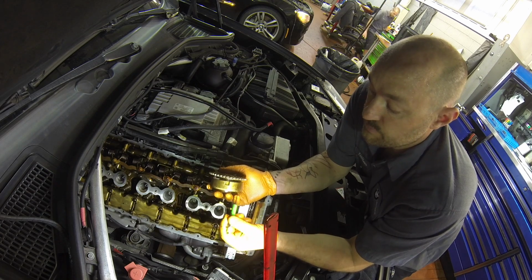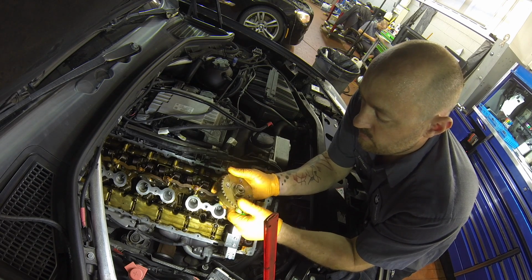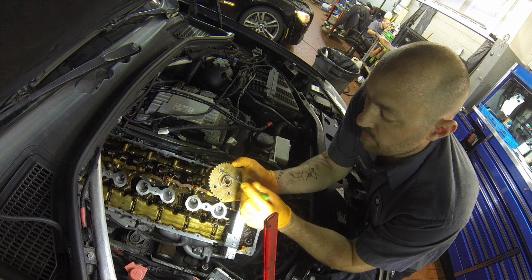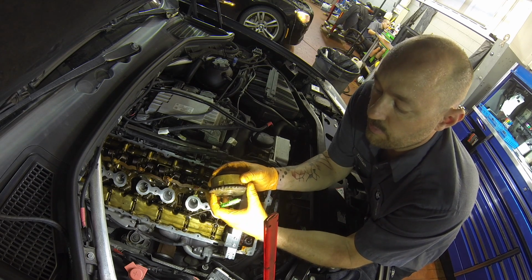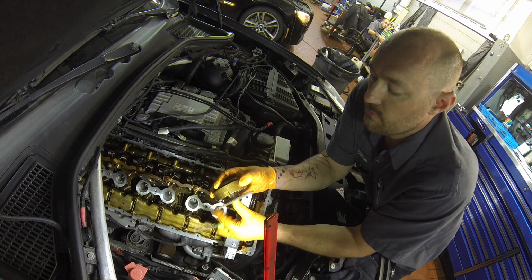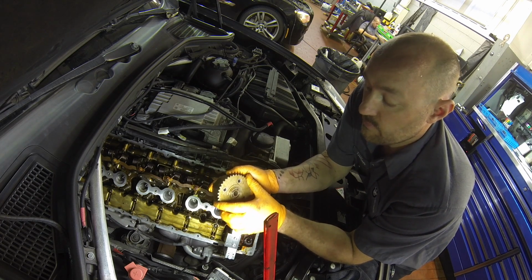Works great most of the time. For some reason they're aluminum bolts. The whole housing's aluminum. This thing weighs like nothing. Real light rotating there. But the newer bolts are better. They are not tamper-proof. Tamper-proof creates a weak area, and the head of the bolt pops off. And the bolt becomes finger tight, and that thing can depart from the camshaft and rotate without turning the cam. Or, I'm sorry, the timing chain can rotate without turning the cam. That's it. So, put it up. Ready to tear apart the bottom end.